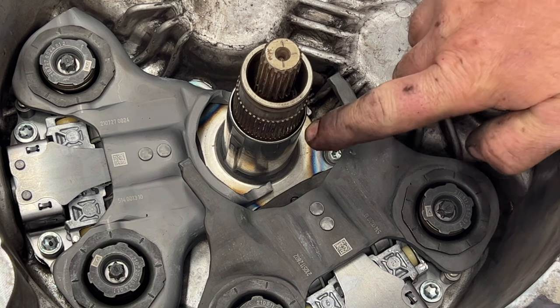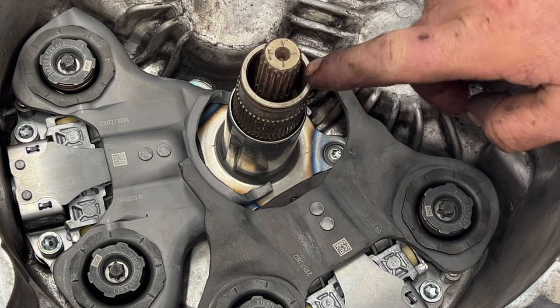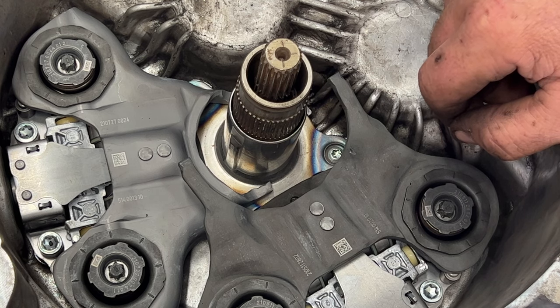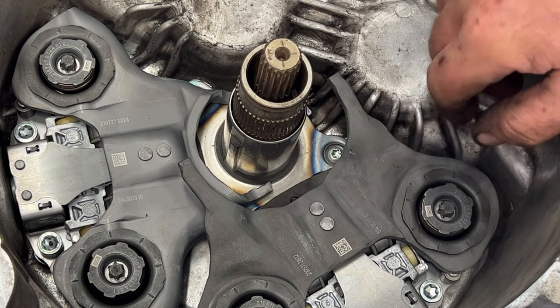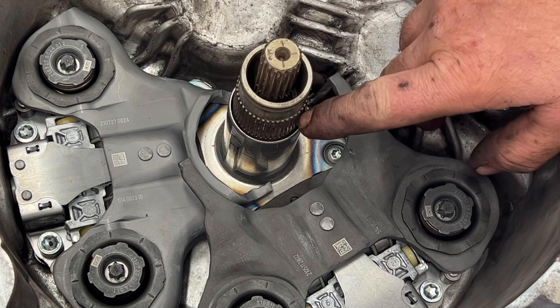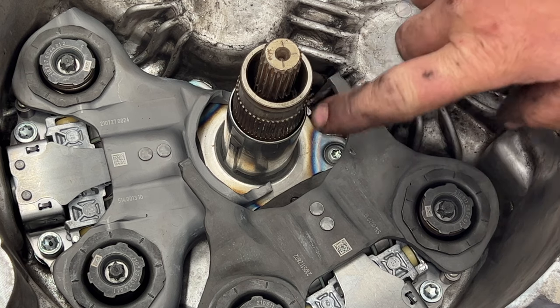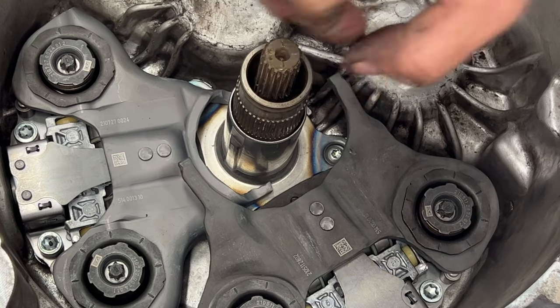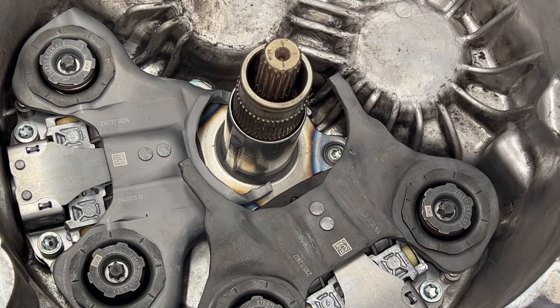All right, guys, so now we need to lubricate the splines. There's a special grease Ford wants you to use. I thought the kit came with it, but it does not. So you will have to buy that separate, and I do not have any of that. So I'm just going to put a light coat of wheel bearing grease, high temp. I'll put a link in the description for the correct stuff. And then what they want you to use is just a little transmission fluid. Just kind of coat this right around here. So let's go ahead and do that.